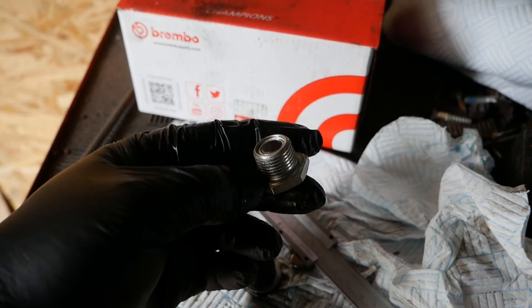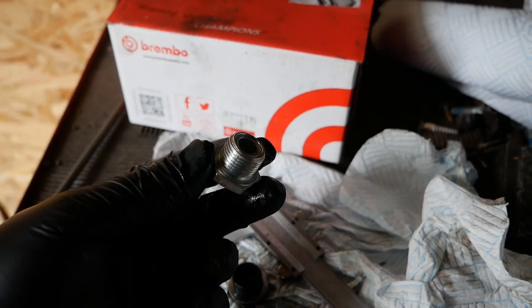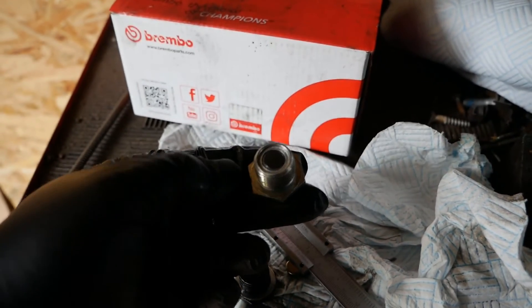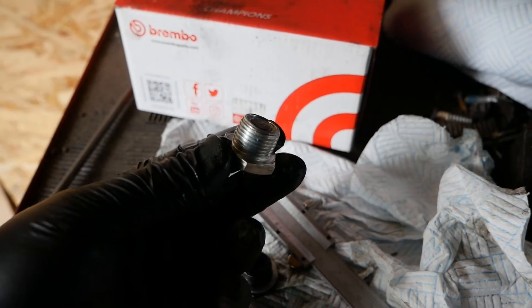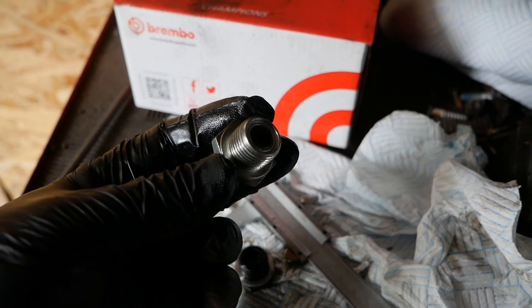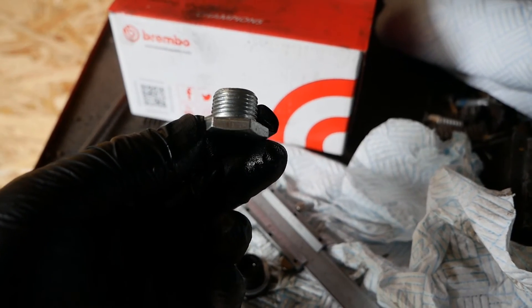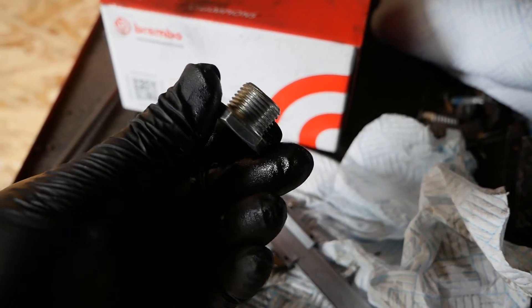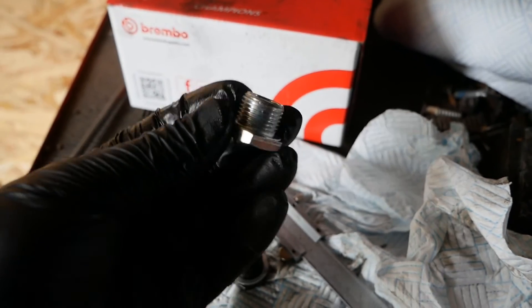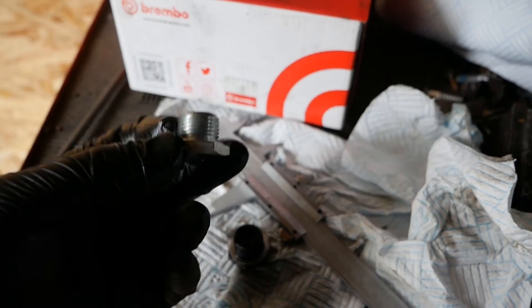This is actually a Toyota one — I'll put the price and part number in the description, along with the details of the crush washer — the aluminium washer that goes on this. I just bought Toyota ones but they're bog-standard: 18 millimeters inner, 24 millimeters outer. You can buy them in aluminium or copper. All the part numbers are in the description, but you don't have to buy this specific one — I don't think the magnet is particularly strong. It was just convenient for me because I have an account with them. I bought a pair, so I'm going to change both the drain plug and the fill plug.